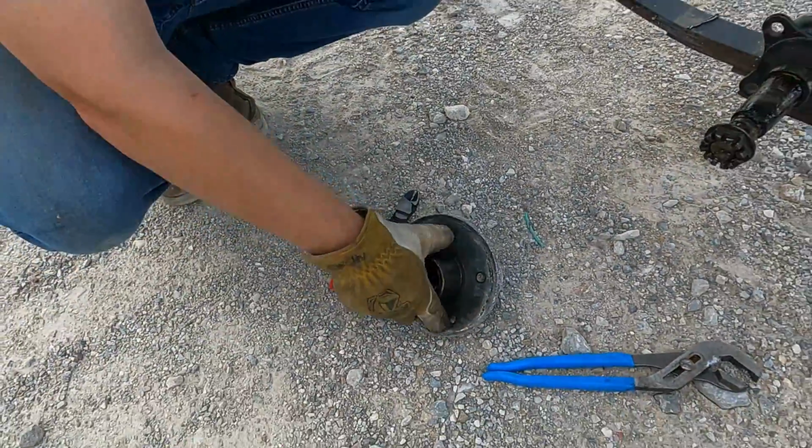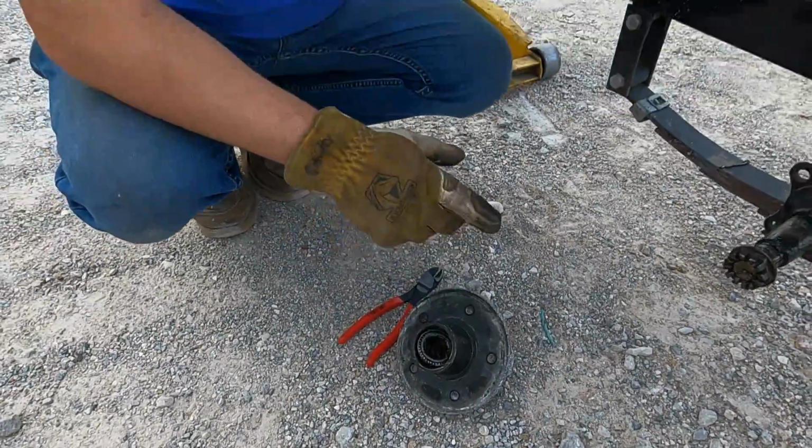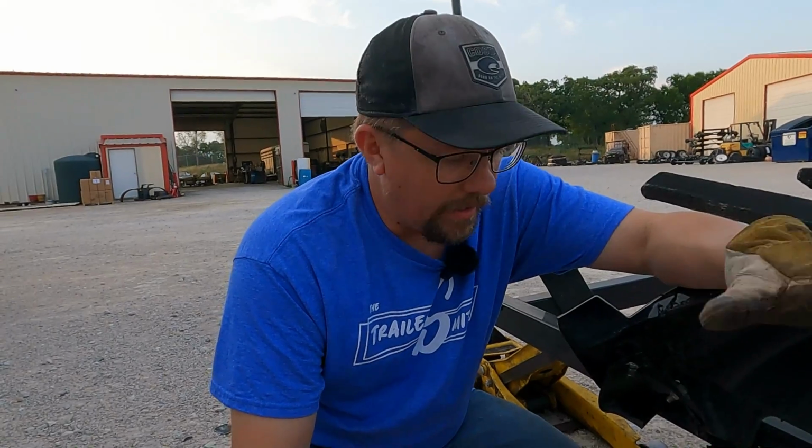And also it's important on the bolt pattern. On a 5-lug bolt pattern like this, you have 4 options. You have 5 on 4.5, 5 on 4 3/4, 5 on 5, and 5 on 5.5. A couple of those are starting to kind of go obsolete. It's really going to go to 5 on 4.5 and 5 on 5 eventually, but there's still a ton of 5 on 5.5 and 5 on 4 3/4 out there in the world.